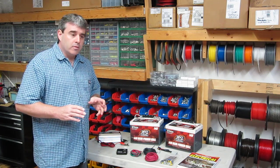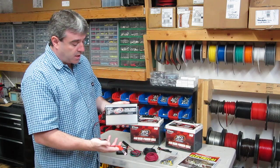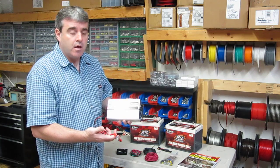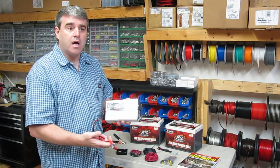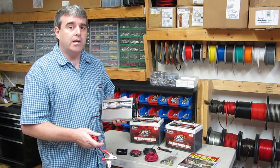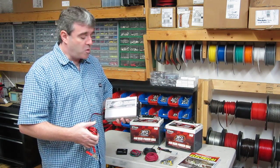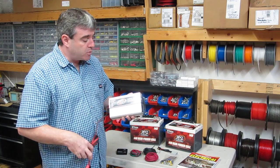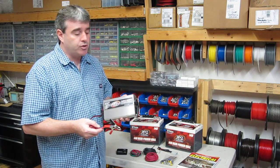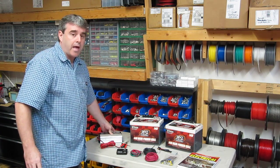The last thing I want to show you before we begin this project is this IntelliCharger from XS Power. This is a 14-volt charger designed specifically for AGM batteries. This is a handy thing to have in the event you leave the vehicle apart for a long time. It is not advisable to start a vehicle with batteries that are not fully charged and let the alternator do that, because that is really hard on the alternator. It performs battery charging in the way that AGM batteries are designed to be charged, and it's very precise in how it does that.